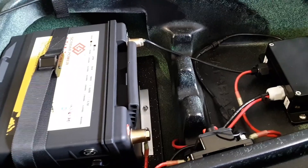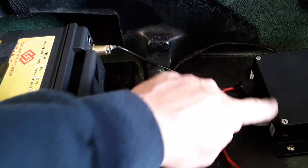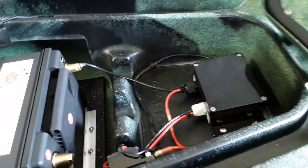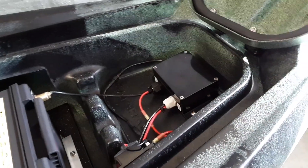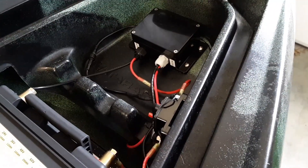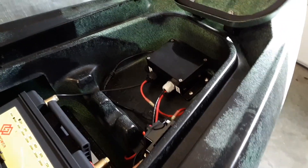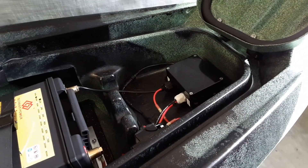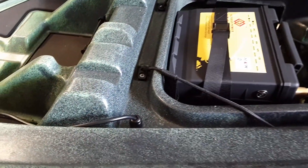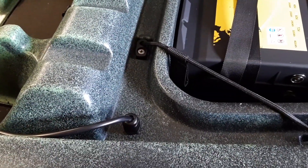I had a half-cut done for this interior hatch — instead of removing the whole interior of the hatch, it's cut up to here so I still have this front area. I use that to mount my ESC unit, and on the inner part of the lip here I mounted my 50 amp circuit breaker. All my electronics fit in there very nicely and when you close the hatch it has a very clean look to it. I ran my wired remote out through here through a gland nut.